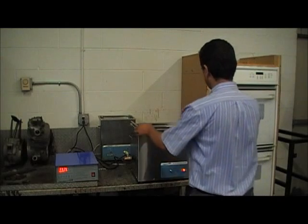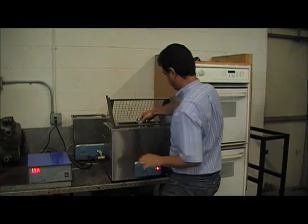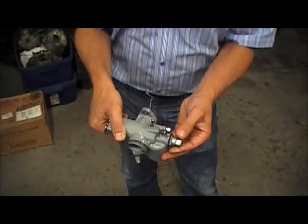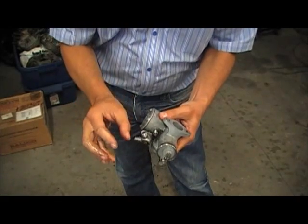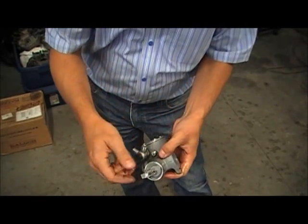I'm going to wait about another minute with the carburetors in the cleaner. Two minutes — I'm going to pull the carburetors out and see what they look like. We can see in about 2 minutes how most of the grime is gone. The shellac buster is totally safe with any rubber fittings, so you don't have to remove any of the rubber fittings.